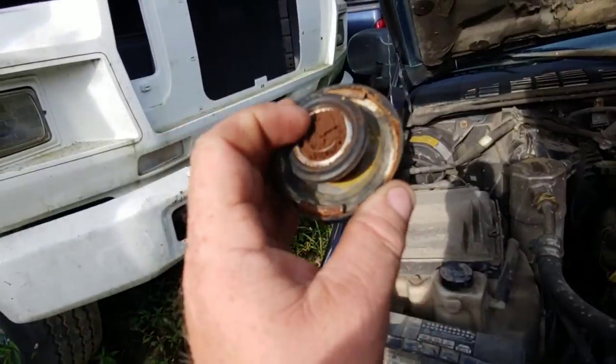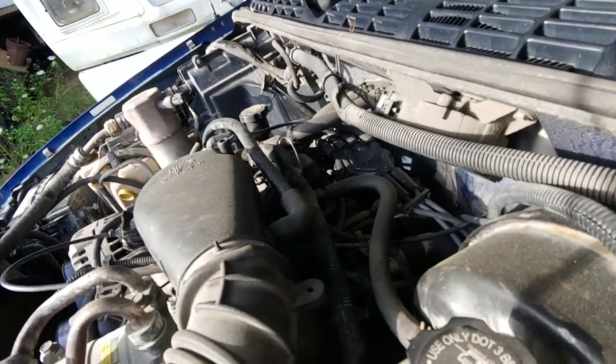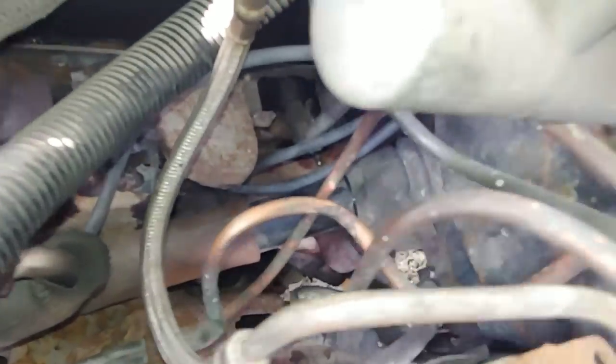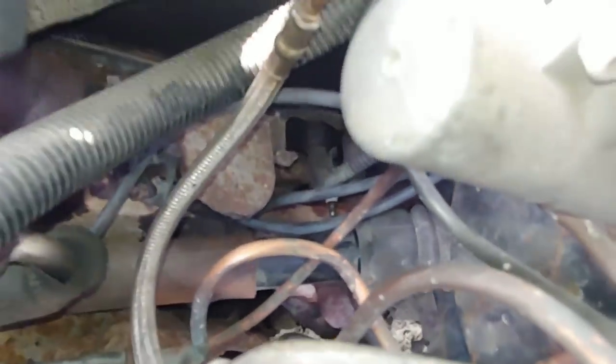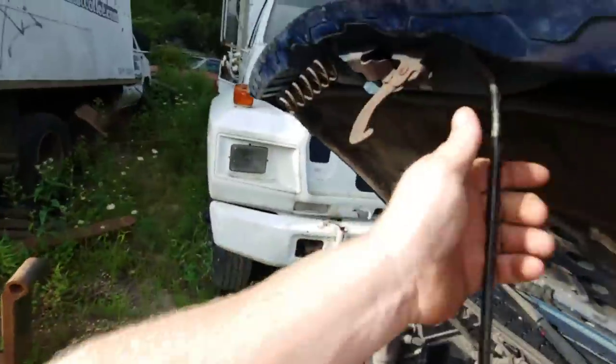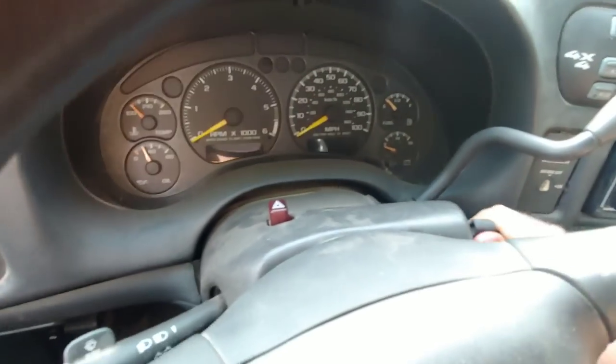Got some water out of the well. Top it off, see what it looks like. Definitely don't look good. Ugh. Definitely shaking. Something ticking too. Can't tell if I'm hearing the ignition jumping or. Oh. Well, that would help down there. I don't know if you guys can even see it, huh? We found the miss. Spark plug wire's not even on the damn spark plug. In all of its glory. Whatever it is. Committed now. I think we got a problem, boys and girls. Come on. Come on, Key.